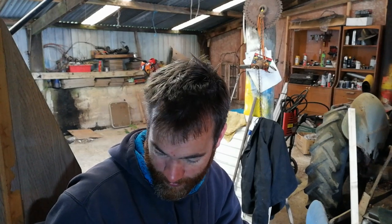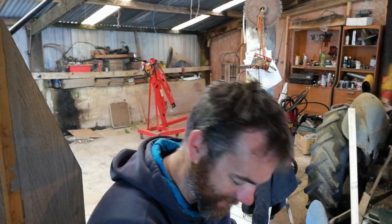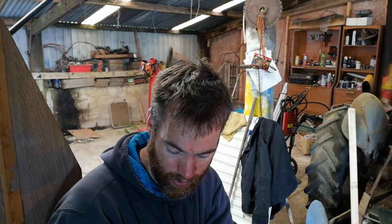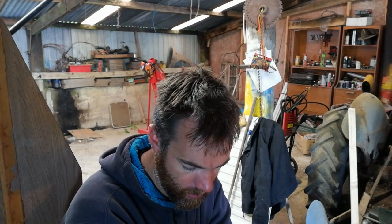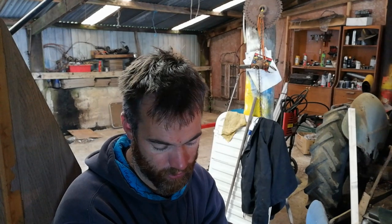And so there's a lot of variables there, and I have a whole bunch of wires here, so I still have to figure out what they do. But we at least know that it runs. When I saw this engine in the car, it was starting and cutting out. So we reckon that he already had a key fob problem with the immobilizer. But there may be something here that I haven't done that's causing that ECU to not send power to that start solenoid.